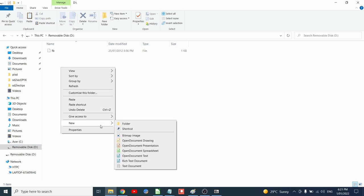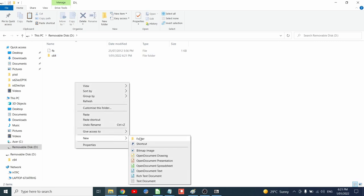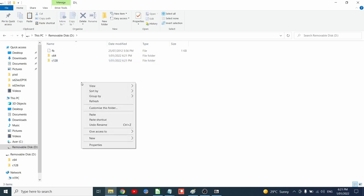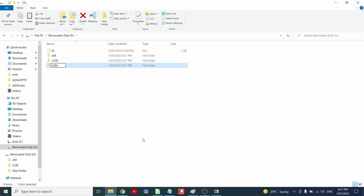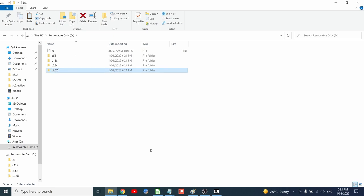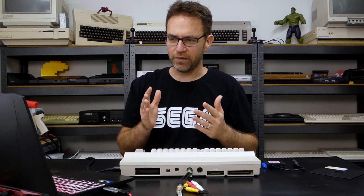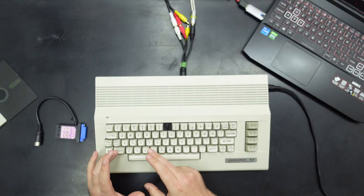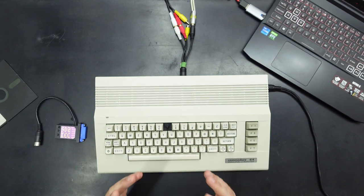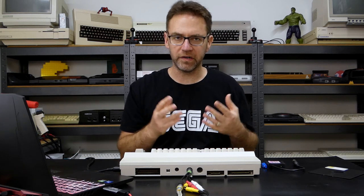After that I'm going to create some directories so they show up at the top of the file browser list — one for Commodore 64 stuff, one for 128 stuff, one for the 264 or TED series, and one for the VIC-20. Notice I'm using all lowercase letters, because it needs to be translated from ASCII on a computer to PETSCII on the Commodore 64. If you use uppercase ASCII, that looks the same as shift plus a letter on a C64, so you'll see weird symbols instead of capital letters.